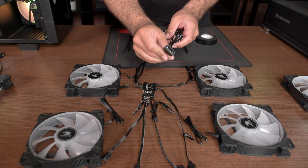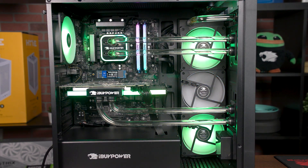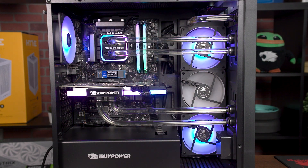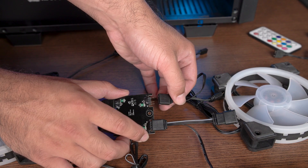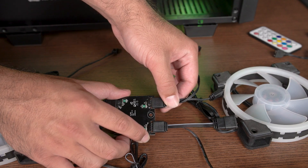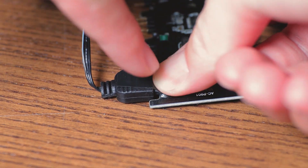All four of these variants require a direct connection to the PC power supply for RGB LEDs. Generally, you are going to encounter one of two situations. The first is where a single RGB component, such as a fan, is not lighting up. The second is when all of the exterior RGB is not working. If you only see a single item not lighting up, it is more likely that the individual wire connecting that item to the central hub is loose. Some of these RGB connectors are held in only by friction, so they can slip out during transit. Take the metal side panel off of your case and inspect the wiring. If you see any loose female ends, look for the male end nearby to plug it back into, taking care not to plug it into itself. If the connector feels especially loose, you can add a small piece of tape to keep it together as you close the side panel.